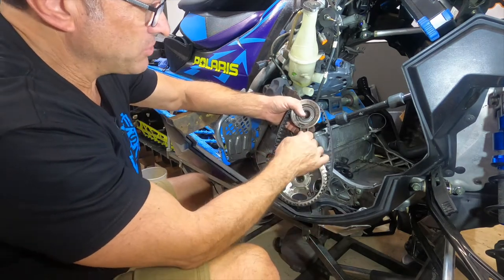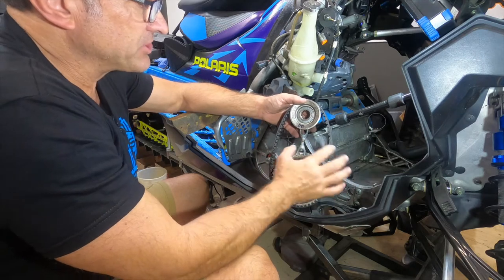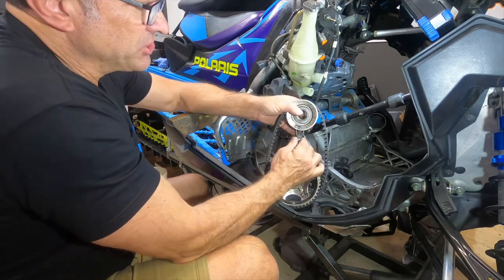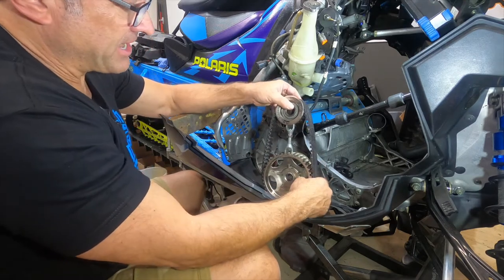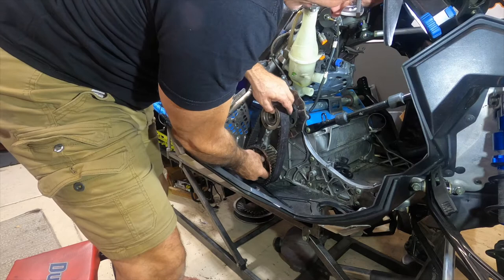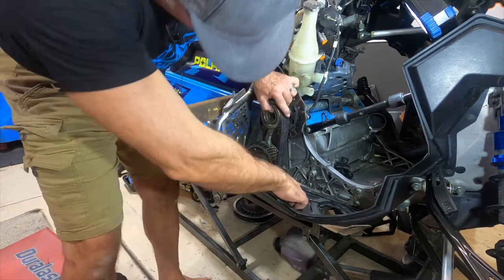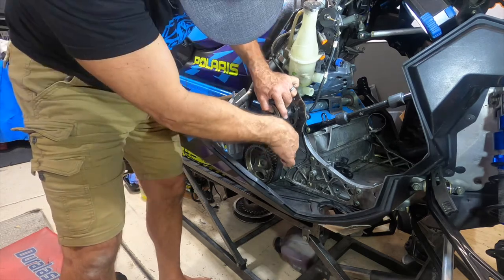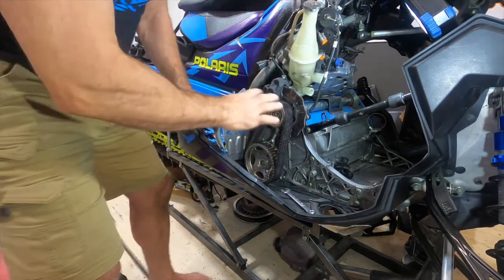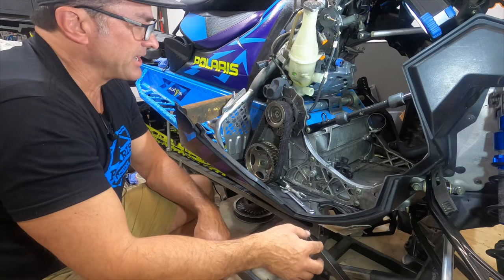The other way is with this little tool we made. If you want to build one of these, the stuff you can buy at Ace Hardware for a few dollars. Just search 'quick drive belt install tool' on YouTube and you'll find it. This nut in the middle turns and pushes the two gears farther apart. You start the bottom in first to get it contacted in the teeth, put a bolt in to keep it engaged while you work on the top tooth, then tighten this nut a bit more. Once it's on, remove the tool, tighten the bolts down, and add blue Loctite.